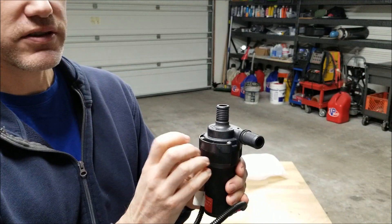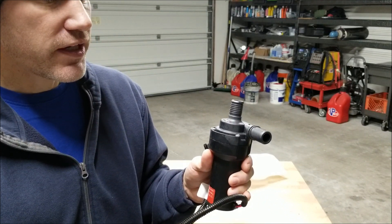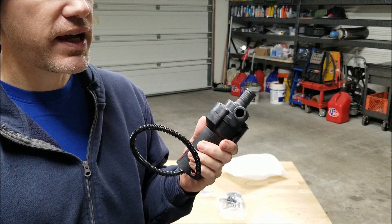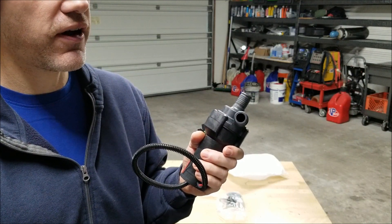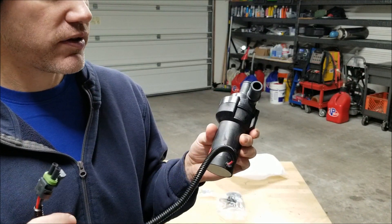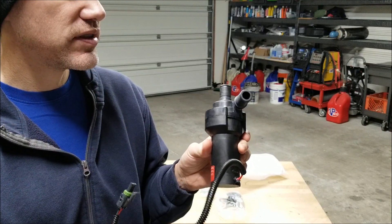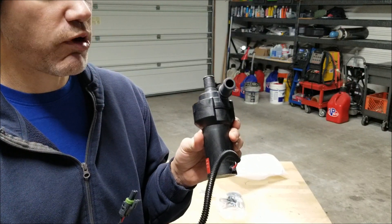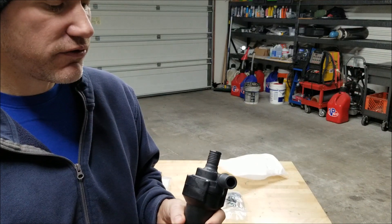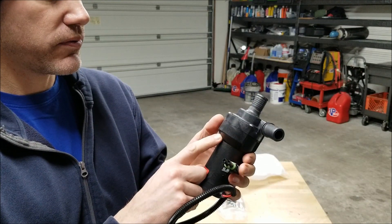I'm currently using a Toyota Prius pump, which is significantly smaller than this. On top of that, the Prius pump is rated for like 14.5 volts for its flow rate. So what happens is overnight as the battery level goes down from the heater cycling on and off, the flow rate decreases. This Webasto unit is about 80% more efficient and rated at about 11.5 volts, so the flow rate stays within the parameters the Espar heater requires. Prius pumps do work and work well, but they're not as efficient as an actual Webasto or Espar pump.